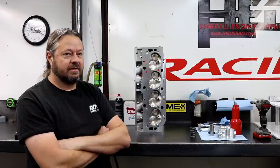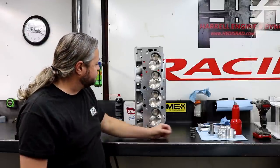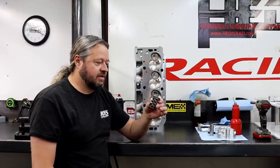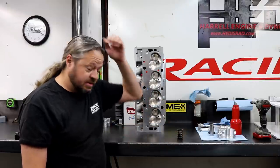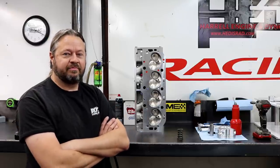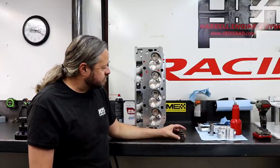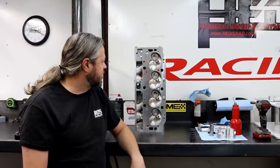As you buy them, they aren't really cylinder heads in the proper sense. They come equipped with this little valve spring here, which has a grand total of 70 pounds of seat pressure — I have ballpoint pens that have more spring pressure than that. As a result, this thing dropped a valve, messed up a seat, made a big mess, and the guy had to bring it down here so we could fix it.